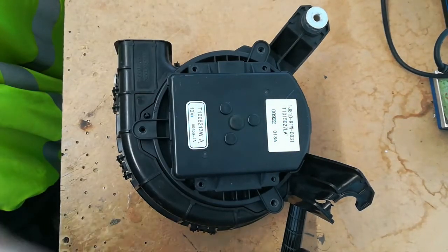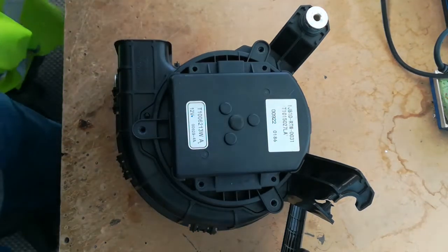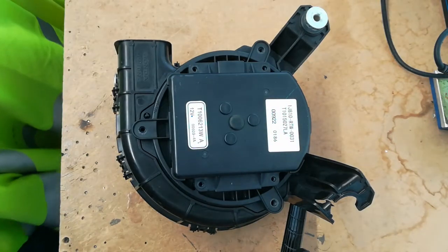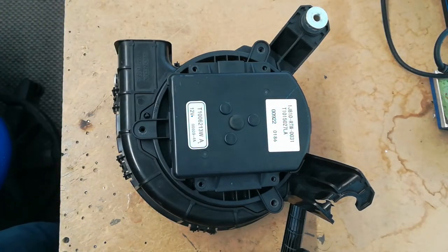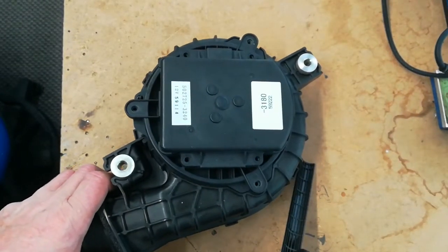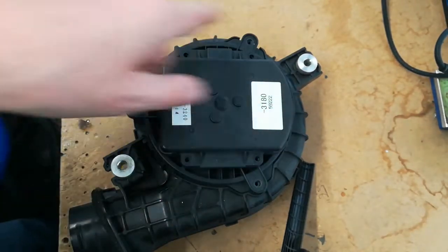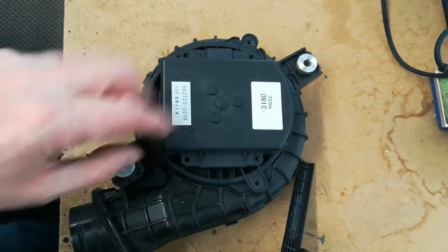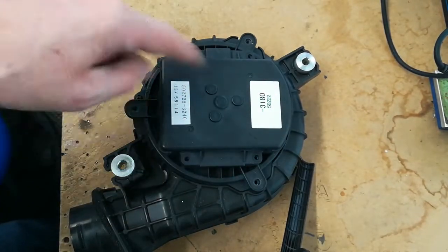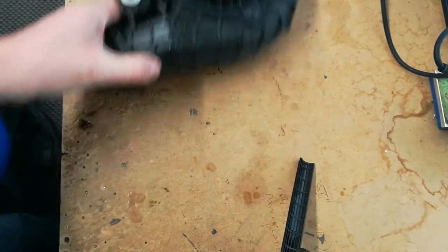You can see the module — I've taken the screws out just to show you what's what. What I want to show you is that there are equivalent fans around and you don't necessarily have to replace the whole unit. This is the CRZ one, and this is the HCH2 or HCH1 fan. You can see the outlet design and the mounting is different, but the actual fan impeller itself is identical to the CRZ one.